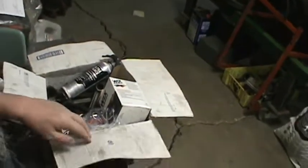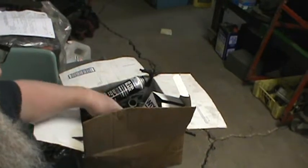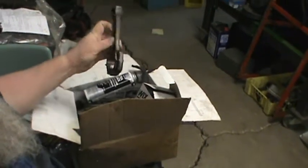So yeah, I got thinking about that, and it was easier to find because I had moved, because actually those rods were right there on the bottom shelf of that toolbox. Actually, here they are. So yeah, the block that these went to is long gone. Actually, I never got it back from the machine shop because there was a little misunderstanding. They bored it and it was ready for pistons. I told them just to clean and crack check it and measure it to see what it was going to take for a bore. So then it ended up the block they gave me, that was one of their cores, was a 30 over block. That was a little tight. So we honed it, put it together, and it's running. So actually, I kind of got a machined block for little nothing that time.